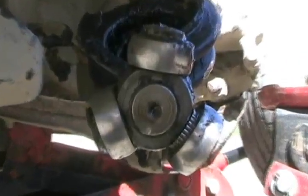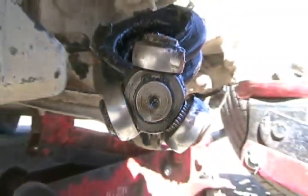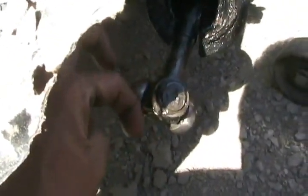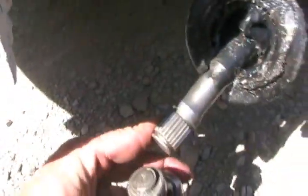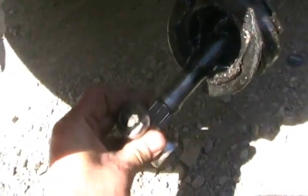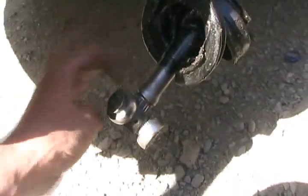There, upon removal of the grease, you can see that clip really well. No problem taking it off. Done. Now I can just slip this thing a little forward. A few taps with a hammer. Oops, too far. So I've cleaned all the grease off so it doesn't contaminate my weld, this part and that part. And I'll set her about halfway out. Run my weld.